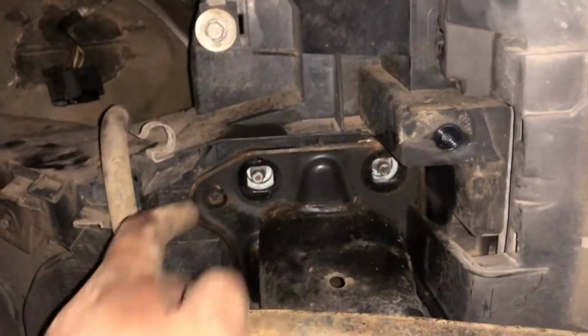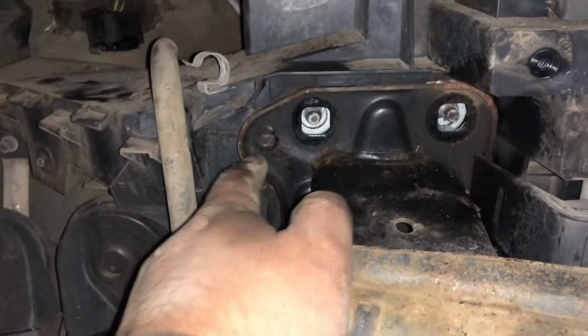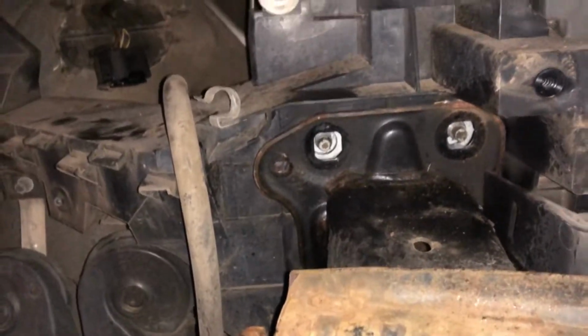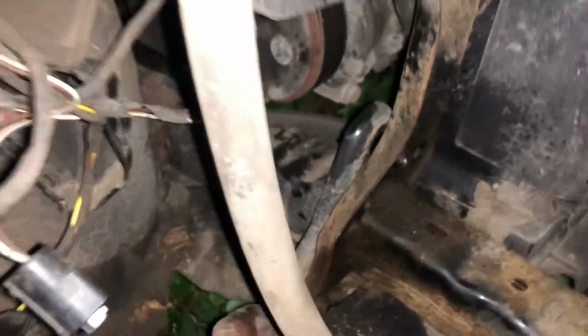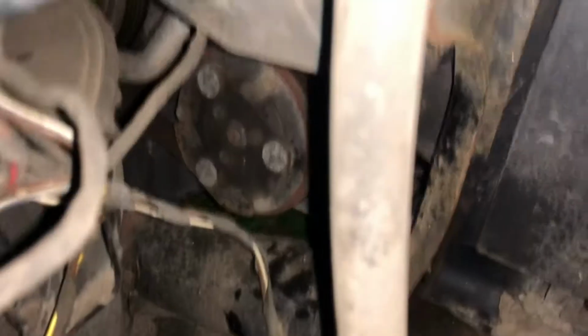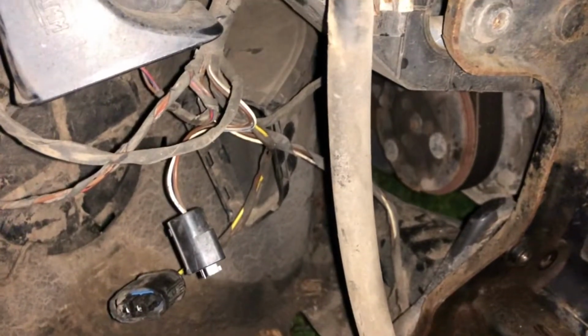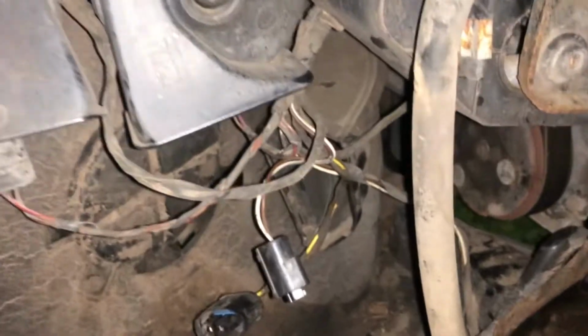And some T20 Torx bits, which go in these little holes here. There's one there, there's 3 or 4 on each side. So there's these 15mm bolts up here. Then there's some 13mm ones down here, which you have to get to from the back. Then there's a 15mm, which is just behind. Over here, you have to do it from the back. So the air ducts from here, I've had to take those off and push these wheel arches back.